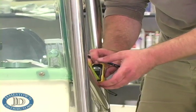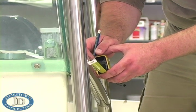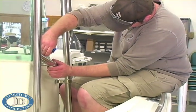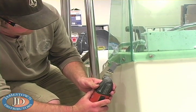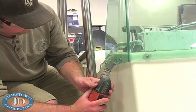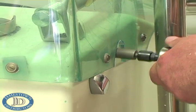Take a good look at the different styles and lengths of standoffs available to you. Standoffs may clamp anywhere on the uprights. Choose your locations and standoff styles so that the base of the standoff lands on a good mounting location on your console. You may find a combination of standoff styles and lengths that works best on your boat. We recommend four standoffs, one for each corner of the console. Choose the shortest standoffs you can so the room you have to walk around your console is maximized.